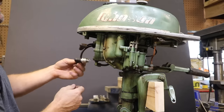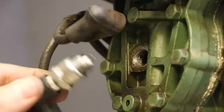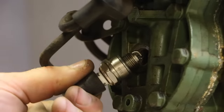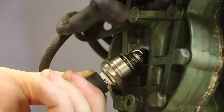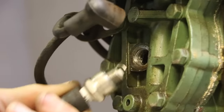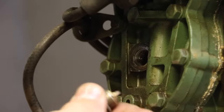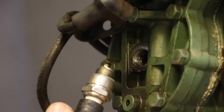Wouldn't it be funny if I just got a bad plug? We're gonna see if this thing is gonna spark. Same plug, same cylinder, and I'm turning it with a drill up here. I don't see a spark. Let's go one thing at a time — I'm gonna put on the spark plug that I know was sparking and we'll see if that one sparks.